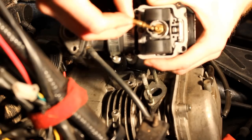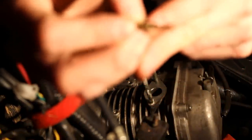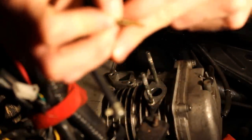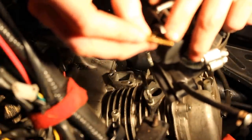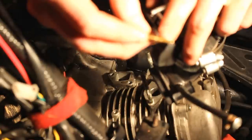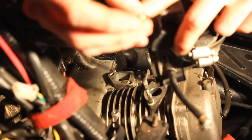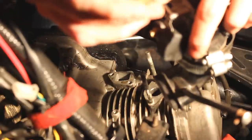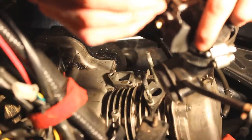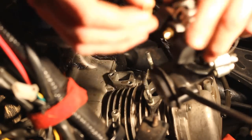The pilot jet is long compared to the main jet. This is the pilot jet. There are tiny holes down at the bottom — if you have an air compressor, just blow those out. Also blow out the hole from the top to the bottom completely. If you don't have an air compressor, just use a trash bag twist tie — take the paper off and use the metal wire to go down through there.